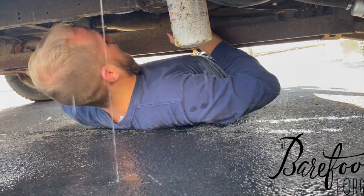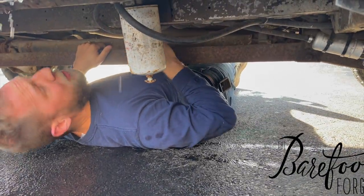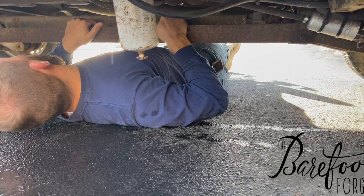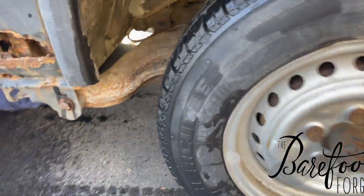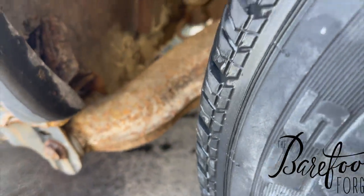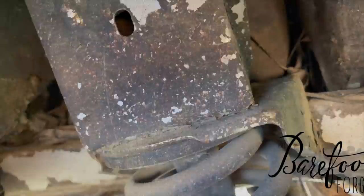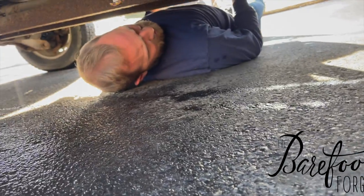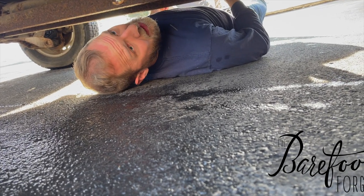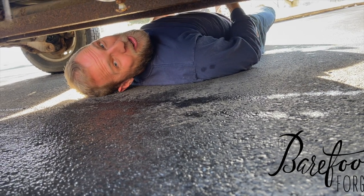It runs, but this coolant hose is older than the import I believe. This hose clamp here is new, and that hose looks new. The fuel pump looks new. There are a couple of torn boots — no big deal. Looking at the actual trailing arms, they're in good shape. The suspension is okay. The things that concern me are the fuel tank. If you pulled the tank and did all that delightful maintenance we just did on Blue, I think it's a good time to fix all the stuff from below — then you're done.